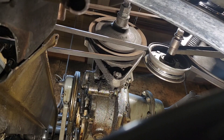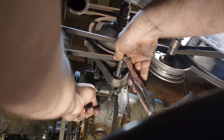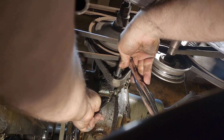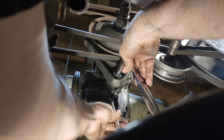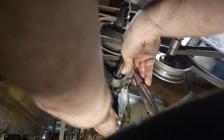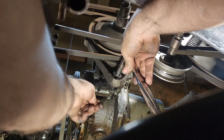Adjuster screw on the bottom of the yoke is where we want it. We're going to go ahead and tighten the jam nut for that. I'm just going to hold the socket wrench there — actually this might be easier, let me grab a speed wrench. All right, coming back in, tightening that nut down with the speed wrench. There we go, now we're tightening. Okay, that's tight.